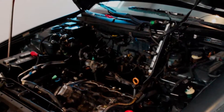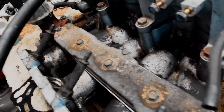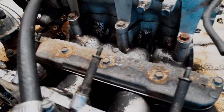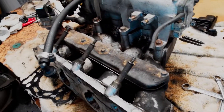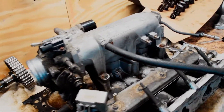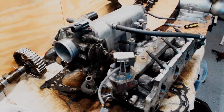I'm going to tear down the intake over here — take off all the hoses and everything to clean it up and give it a nice coat of paint. I'm going to take off the EGR too, which is this plate right here. That's the EGR valve — it lets some exhaust gases into the intake to keep knock down and help fuel economy. I'm going to take that plate off and see if each of the four individual ports are clogged with carbon. I'll also take off the throttle body since my gasket kit includes a new gasket for it.